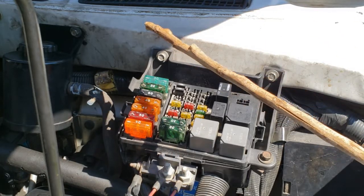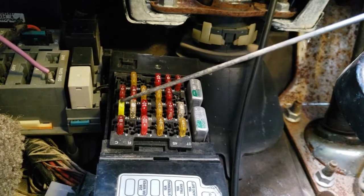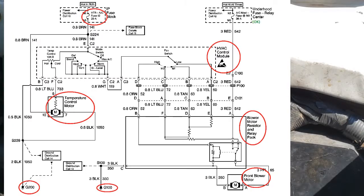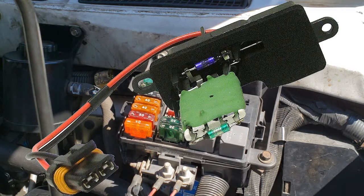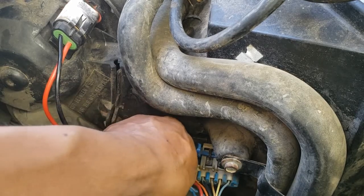Under the hood the van uses one 30-amp fuse and an AC enable relay. In the driver's footwell it has one 20-amp fuse — fuse number 12. In our situation, fuse number 12 blows every time the AC is turned on. Here's the wiring diagram showing which components are on the circuit: the blower motor control unit, in-dash control unit, compressor, and temperature control unit. We disconnected all four of them and by process of elimination, after blowing a few fuses, we narrowed it down to the blower motor relay and resistor pack. It has been confirmed that the relay and resistor pack is what's causing fuse number 12 to blow, so we're going to have to swap it out.